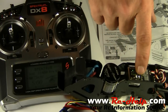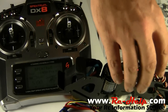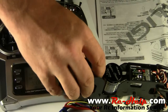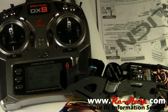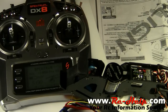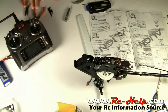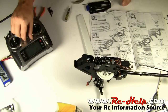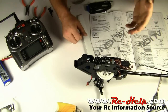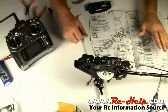That is all the setup you really need to do on here. Make sure your pots are at 50 for your aileron and elevator. Make sure your wires are out of the way — nothing's touching the motor, like these wires right here getting pretty darn close. We're gonna zip-tie those up out of the way. Once you're done with that, unplug the helicopter and turn off your radio — that's all there is to really setting up that gyro.